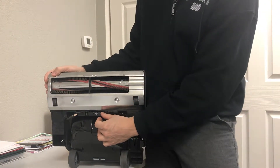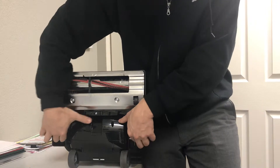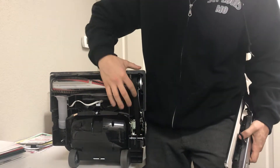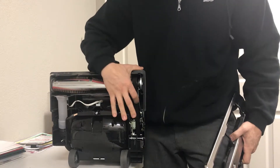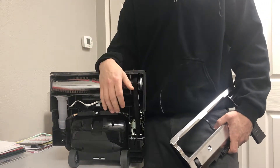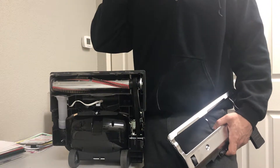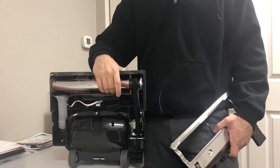Make sure you tell customers that if they have plastic brushes. There's a bottom plate that covers this area. On this particular vacuum, the bottom plate is a quick release — you flip a switch and the whole bottom plate comes off without tools. This is a big advantage. You can also see the belt. This is a stretch belt system, meaning the belt is rubber and stretches to go into place. Some belts are cog belts, geared belts, or serpentine, with grooves that fit into pulley systems — those are higher quality belt systems.